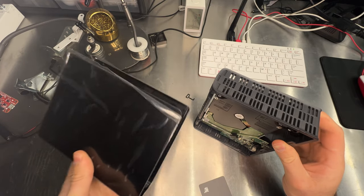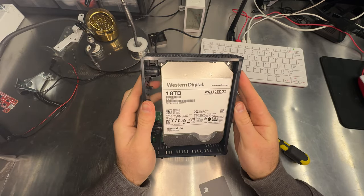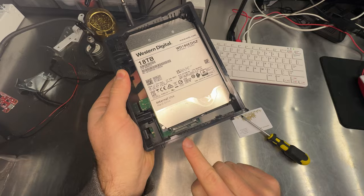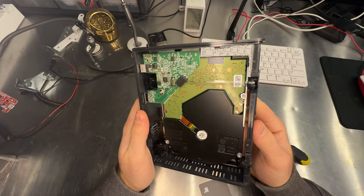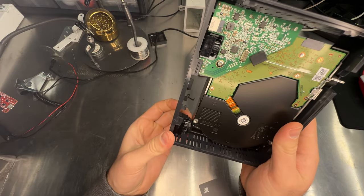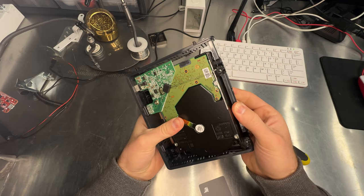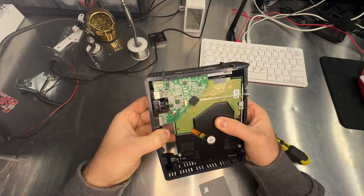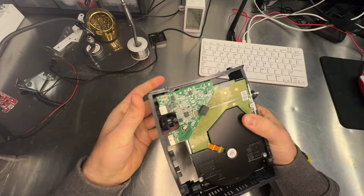It's just a hollow shell. We'll put that aside and look at the hard drive we have in here. It is a Western Digital white drive for internal use, and we have this little board in the back that plugs into it just like a regular hard drive SATA and power connector would. We've got some hidden screws behind these little circles — these mount points aren't that accessible. Just by pushing from the front on the right side it kind of popped out, and I'm going to try to carefully separate everything without breaking anything.